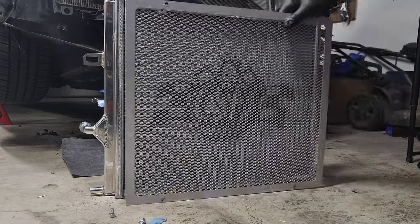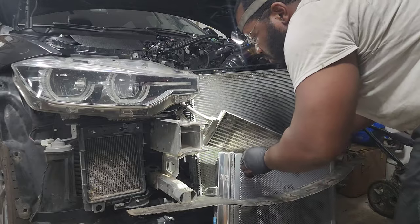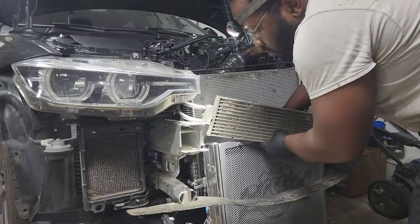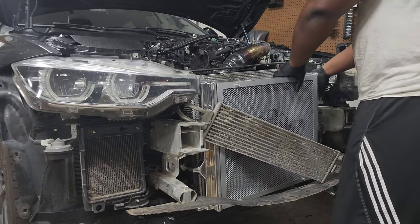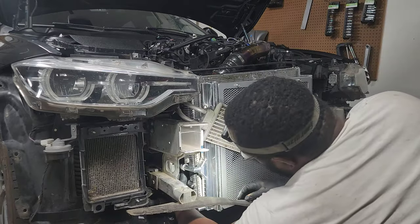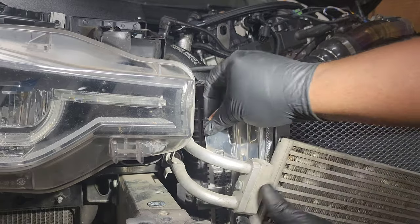Let's get it installed. First we'll put the rock guard in place — it installs simply with four screws through the four holes around the perimeter. Then we'll slide the heat exchanger back up into position the same way we removed the stock one. Keep in mind it won't just sit in place without the rails, so what I found easier is to snap in the coolant hoses on each side first — that holds it in place while you get everything else situated. To snap in each coolant line, push the C-clip back on, push the line on, and you'll hear it snap and lock into place.